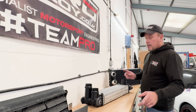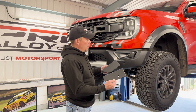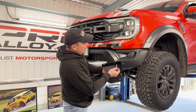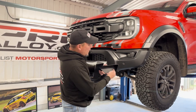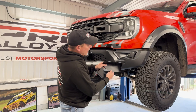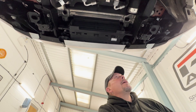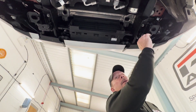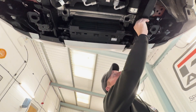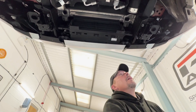The next thing we're going to do is swap those towing eye brackets over on the chassis and offer the new intercooler into position. So here we have left and right intercooler brackets which will bolt up to the chassis leg with the original forward bolts. This bracket will be sandwiched between the chassis leg on top and the heavy-duty towing eye brackets underneath, with the intercooler mounting holes at the rear of the bracket. We've bent our tabs on our towing eye brackets and put the intercooler brackets between them and the chassis legs, left loose so it's in situ. You can see how those brackets have easily swapped over from left to right — no harm done — and of course you can put all this back to standard if you need to later on.